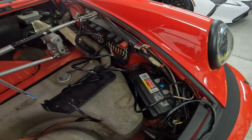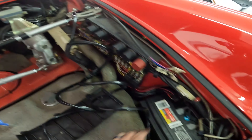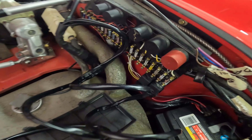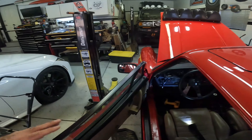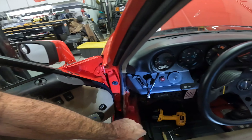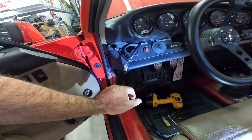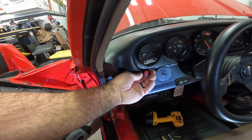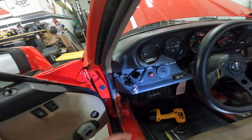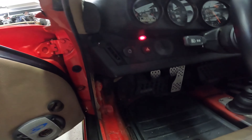Porsche makes it really easy to wire things in these cars because you get your battery right here and all of your fuse block. Look at these old-school fuses — I remember those from my old Volkswagen Beetle days. I'll show you where I'm gonna put the switch. On Porsches, all the lights are over here on this left driver's side area. You have your headlight switch, your emergency light switch, and I'm gonna mount this switch right underneath the dash pod there with this little red illuminated switch to kind of match everything.